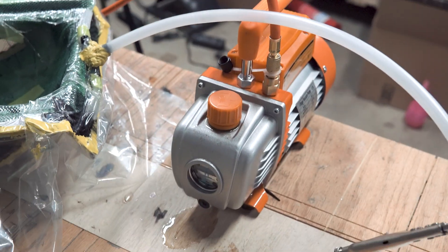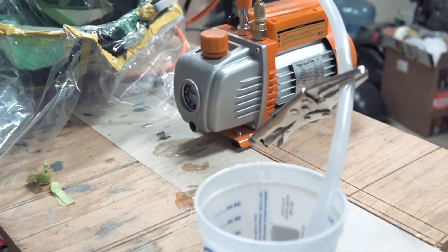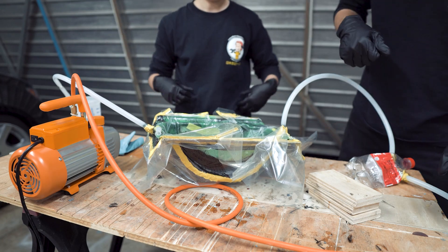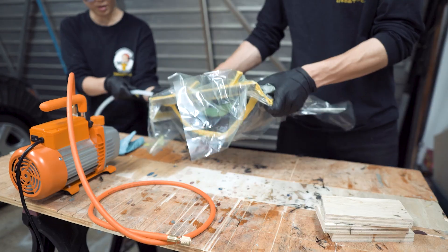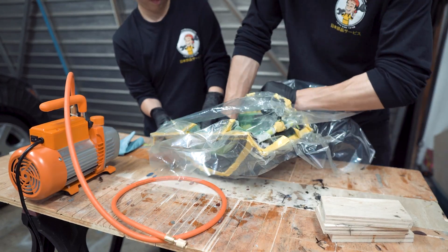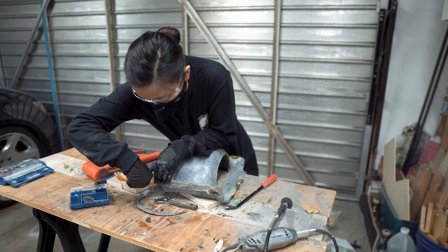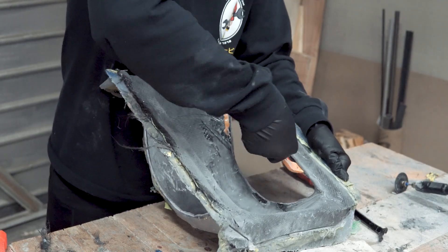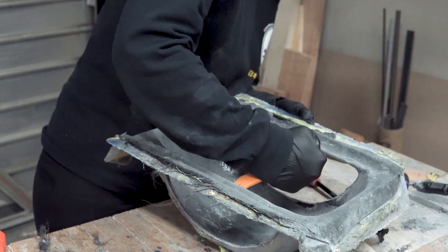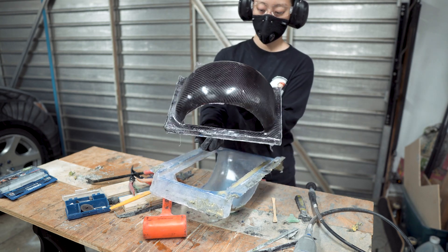We attached the vacuum hose to the tees — one end goes to the vacuum pump while the other dips into a bucket of epoxy. After letting the fender cure overnight we were eager to take everything apart. However, epoxy had pooled to one side and cured while we lost time maneuvering the vacuum fitting. In hindsight, we should have used 5-to-1 epoxy resin with a slower cure time to give us more time to work with the vacuum bagging process.